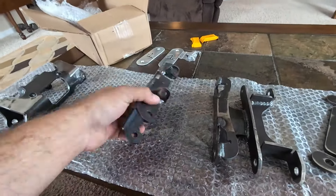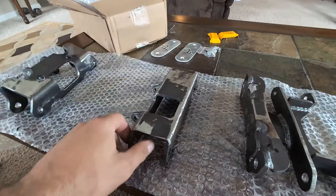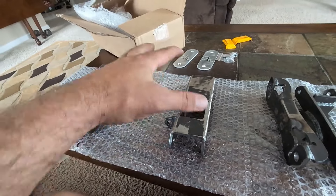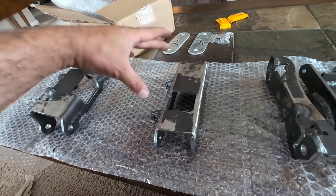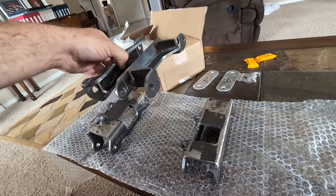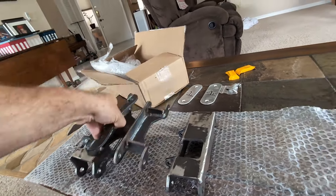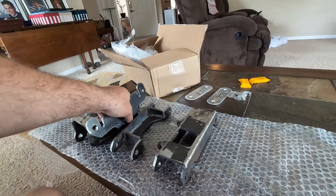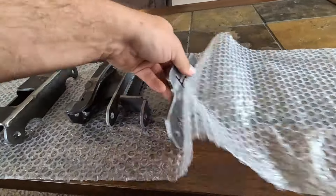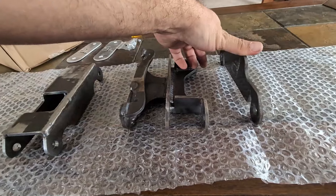And then I think this is your rear tab reinforcement — it probably goes like that. I think this ties into your rear diff bolt, so again integrating things together, getting a lot more strength out of it. It adds weight and integrates your tabs into your rear diff very nicely. Then this goes up here and sits on top of your rear diff and reinforces a bunch of the upper tabs — three of them. And then this goes back here. Let's say these are your upper control arms — yeah, this lines up at that. So this goes somewhere else and that reinforces all your upper control arm tabs.